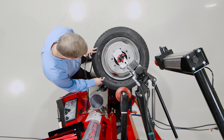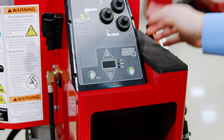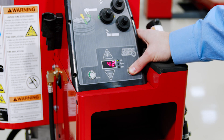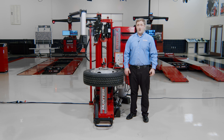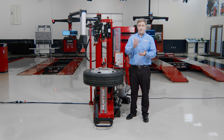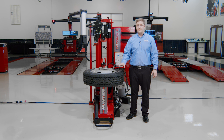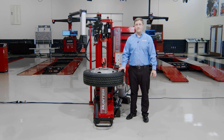With this tire I'm going to have to air up past 40 PSI. My automatic inflation will only go to 40 PSI, but if I need to go past 40 PSI — for example, on these heavy duty tires — I press and hold my manual inflation button. If I'm pressing and holding that, I get an inflation pulse and a pressure check, so I always know how much air is in that tire. I can do that up to 60 PSI. So we got this 19.5 tire changed fairly easily. You've seen a wide range of tires changed — everything from basic tire and wheel assemblies, to advanced, to reverse, and all the way up to 19.5. Very capable machine. For more operation videos, tips, and tricks on our other equipment, visit hunter.com. Thanks for watching.